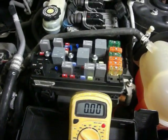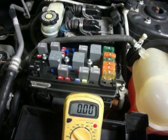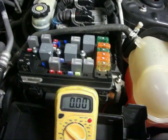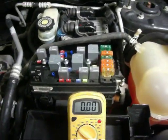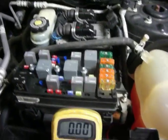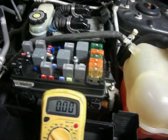With the AC on, the fan should come on. Now, some vehicles have just one speed — the fan is on or it's off. This particular vehicle has a low and a high speed. If the low speed comes on, that's for a lower temperature. You're going to have to wait until it warms up and the high speed will come on — low speed turns off and high speed comes on. If the high speed doesn't come on, you're definitely going to have an overheating problem.